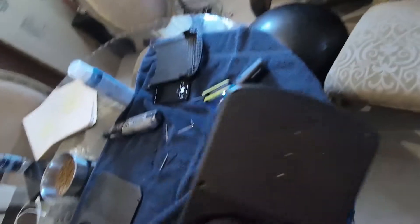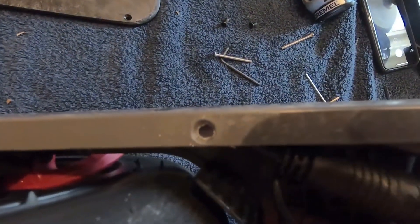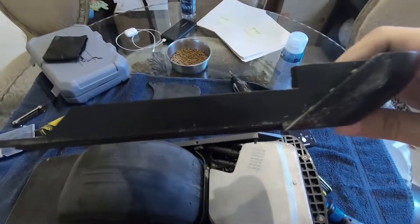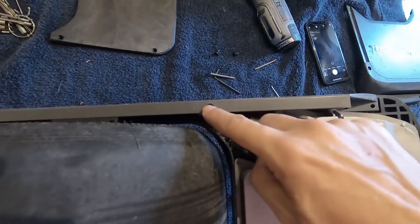This picture is what it looks like before I widen the holes, and this is what it looks like after. Not a huge difference — you don't need a huge difference, it was a small misalignment, not a really big deal. I looked at the bumper and thought maybe I could trim the plastic back, but that's so much trouble, and then every time you replace your bumpers you'd have to do it again. Deal with it at the source — deal with it here. You're not going to affect the functionality since there are no threads in the rail anyway.